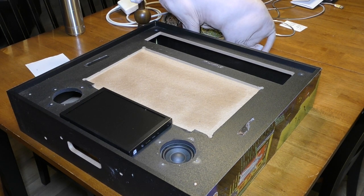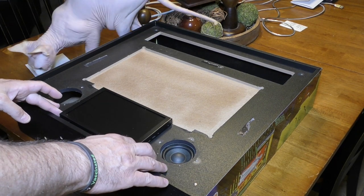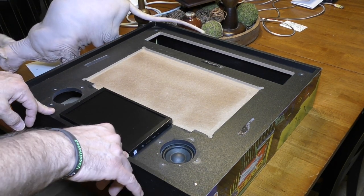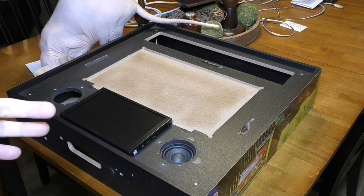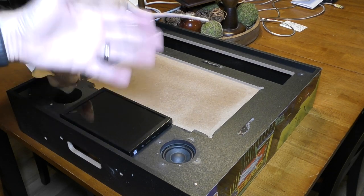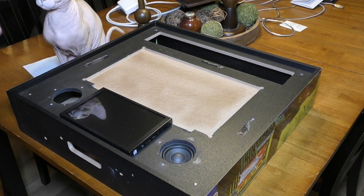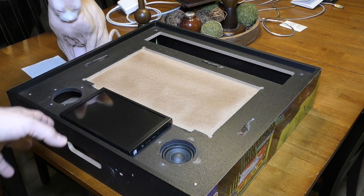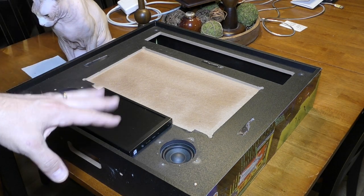So the next step is going to be the Dremel. Because we're working so close to the edge here, I'm going to use a Dremel and cut on the pro side, which I've always heard is more towards the opposite end. You're going to toss that away and then we can file it down so we can get it as square as we need. The big issue is obviously the plexiglass. So let's go out and check this out and we'll cut this.